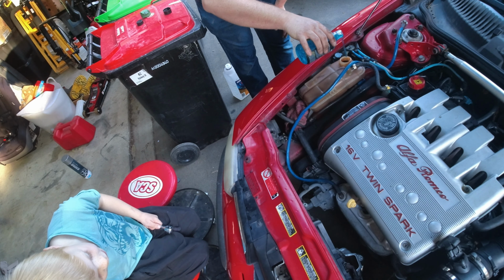Right, so there's our new bits of pipe and clamps. It wasn't too bad, just a wee bit fiddly to squeeze everything together because they're only short pipes, so just a little bit of silicone lube and everything's better with lube. So you'll notice I managed to put one of the clamps on upside down, so I'll point that out just so your OCD can kick in and you can start twitching in the background there. But that should be a lot better than the crusty old ones.